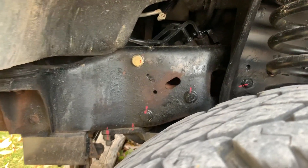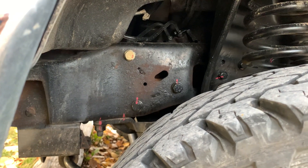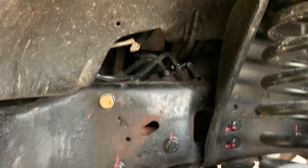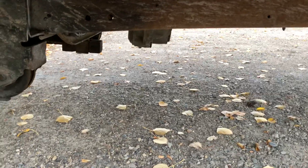I put in an 05 — you can see it's an 08 steering box, but it's the early 08. You need the line for that; it's the one excluding hydroboost, unless you convert to hydroboost, which I didn't.